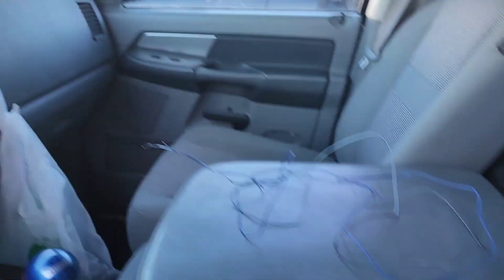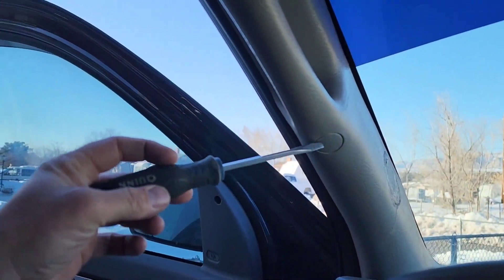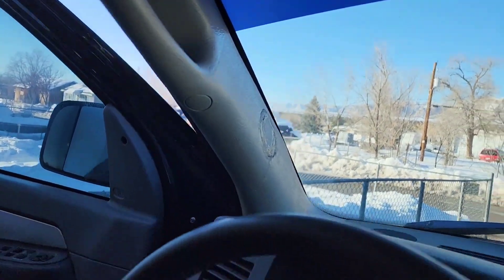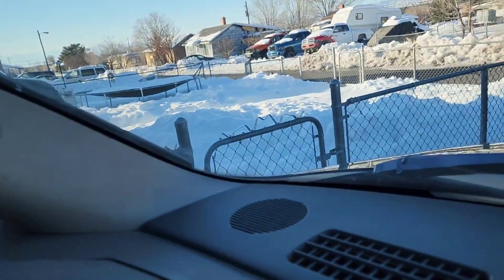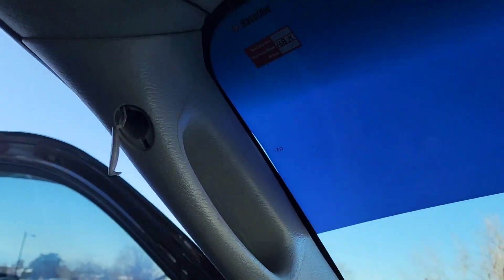All the wiring for that door is done and the marker light works. I now have both of my dome light wires here, so let's get this A-pillar off. You have to take this plug and this plug off — carefully. Up in there, you can't see it, but just take my word for it that there are two 10mm bolts. Let's pop them off.